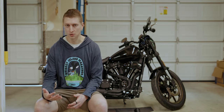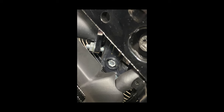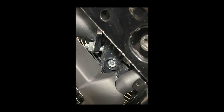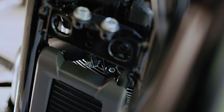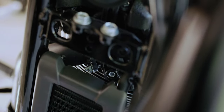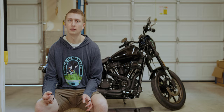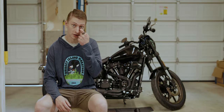And then subsequent to that, I've never seen an exhaust where the flange does not sit flush up against the actual exhaust port, and we were trying to really get it seated and figure out why. We didn't want to over tighten everything, of course, but there's probably an eighth of an inch at least of thread still remaining. The header was being seated in the exhaust port properly, but we just could not for the life of us figure it out.